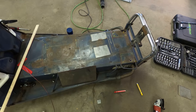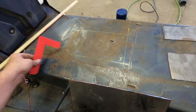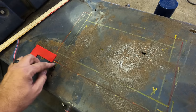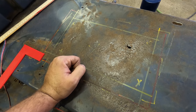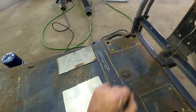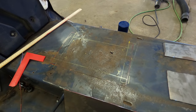Got some pieces sliced out and I think they'll work - we'll snip them right in here. This is all leftover material from making pans for the Chevelle, so no cost there. Bentley insisted on using his square. So the yellow marks are where I'm going to cut, and the red is the actual outline of the piece going in - there'll be a lip so we can set it on for a little bit of strength. Now I'm going to take the cutting tool and hopefully not light the track on fire, which is right there, then get the grinder disc out and clean this up to get ready to weld her down.